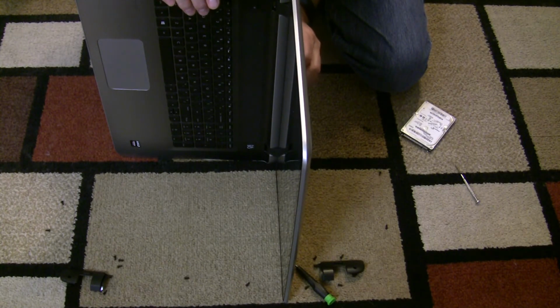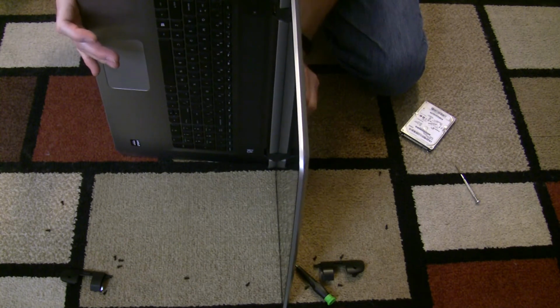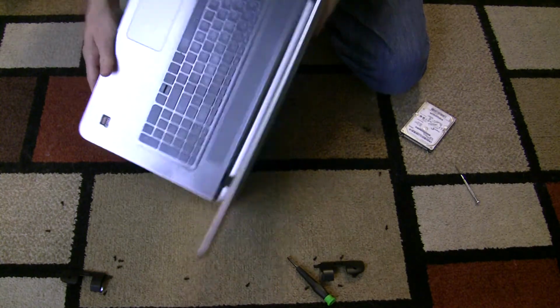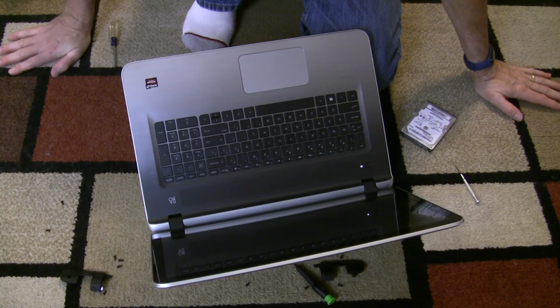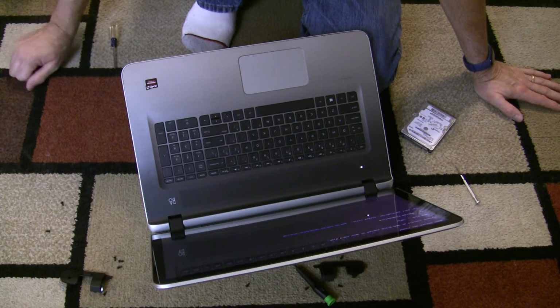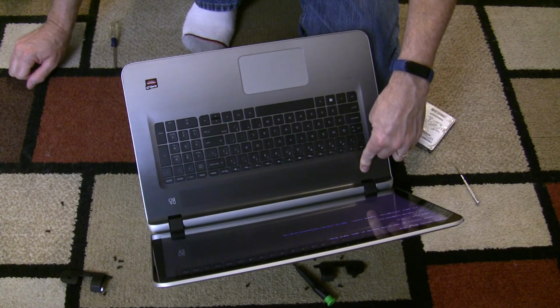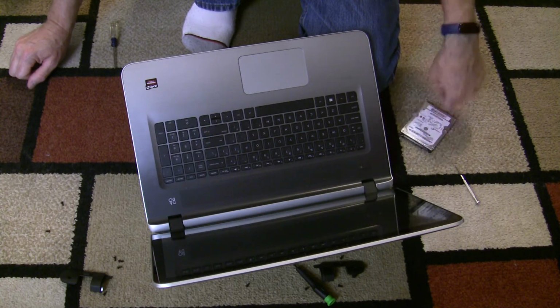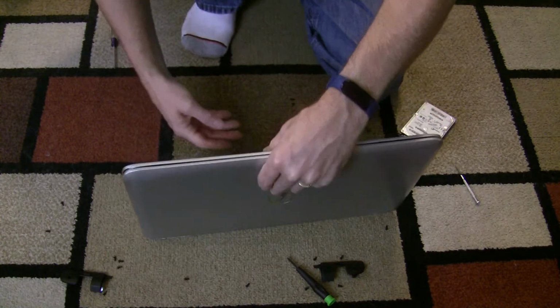I was probably going to freak out because it does not have the right operating system or that kind of stuff. But I just want to make sure it is going to boot up properly before I put all these screws back in. So it says please install an operating system on your hard drive because it does not have one, but it's booting up and it sees it, so that looks good to me. So I'm going to go ahead and put the rest of these screws back in and install the operating system.